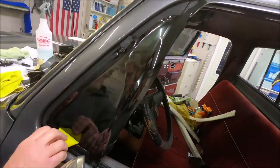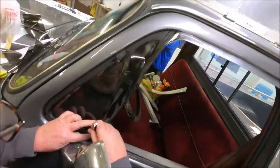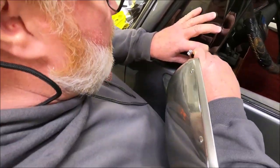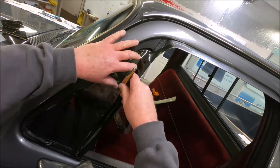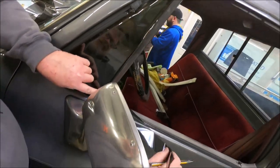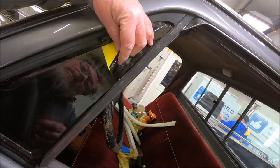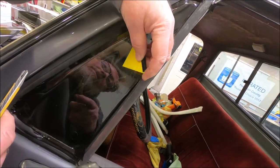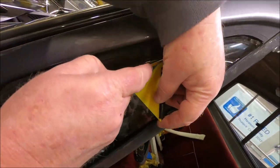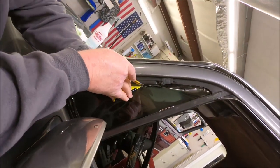When I take it off, I'll know what we've got. I'm gonna cut this a little bigger — it'd work a little better when I install it. I'm cutting this little piece of film out so I'll have room. If you ever want to take it — don't pull or you'll rip your film. Hold your finger tight and snatch it out like this — it'll leave a little dog ear on it. I'm gonna start right here and push this in. Instead of trying to get up in here and cut the angle and mess up my blade, I'm gonna put this thing straight on it and cut straight into the glass.